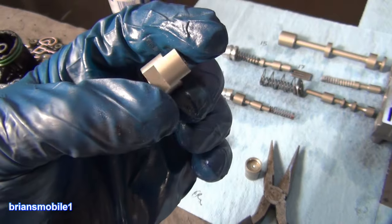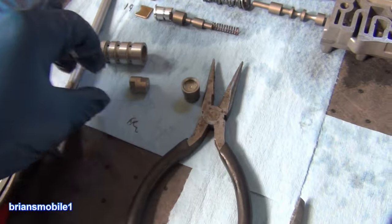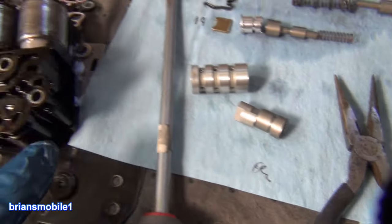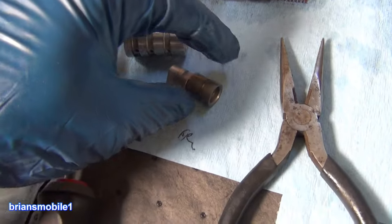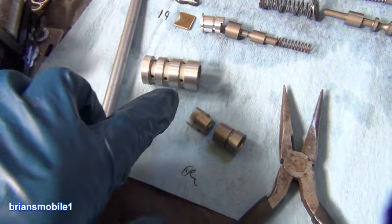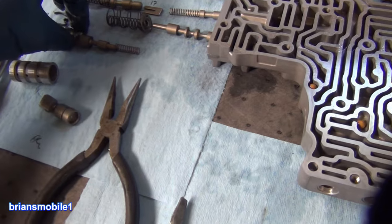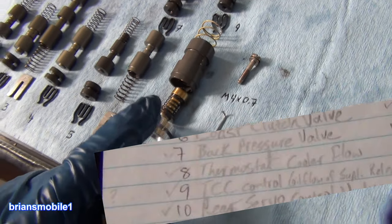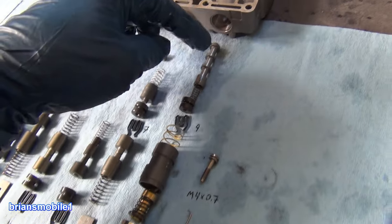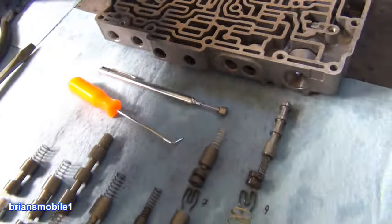This one is symmetrical rotated — it's kind of cool because you can put it either way. It's got a bump on each side, goes in the back, and these two pair up to each other. Depending on whether these are working properly, they'll split, push from the back, and do all kinds of things through here in order to get the pressure where it needs to go and boost it where it needs to be. This is the thermostat — as you saw, it's number eight — and I think this one's torque converter clutch related. It's just hiding in here; this is just the convenient way they stacked it.